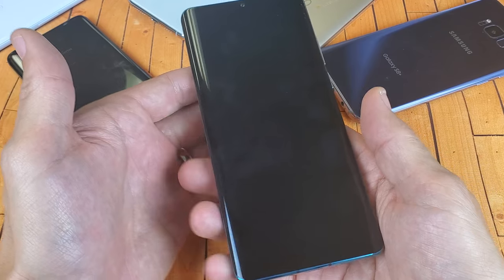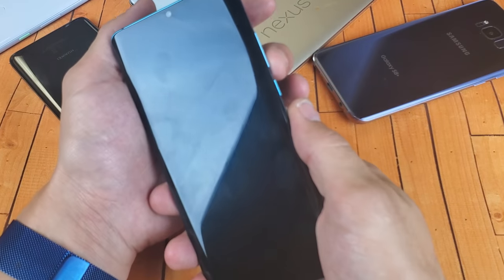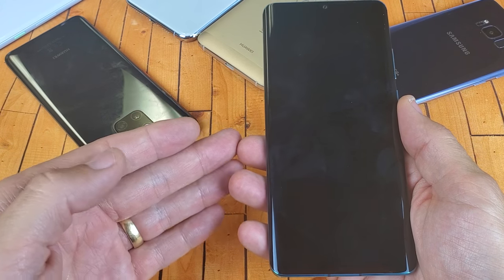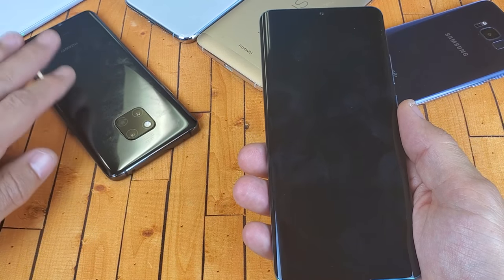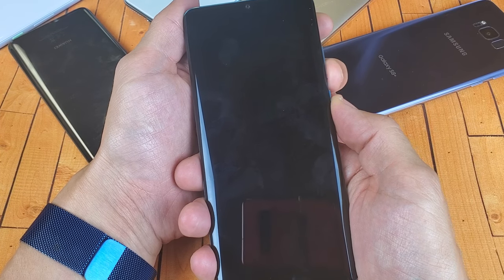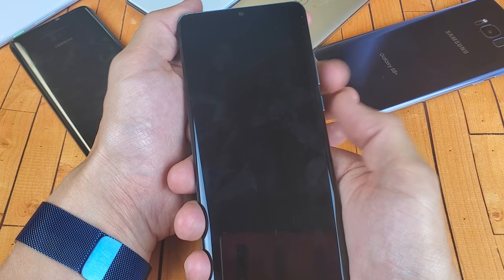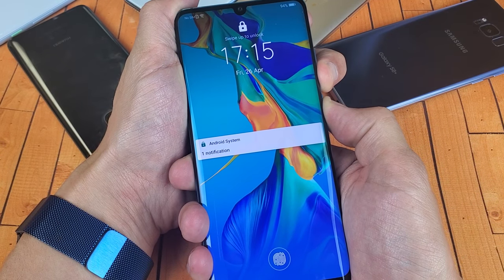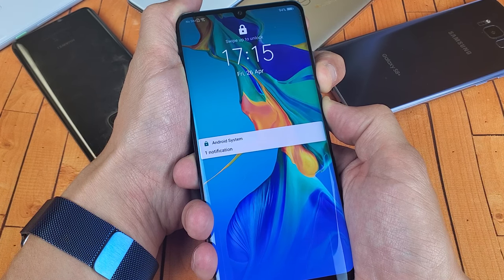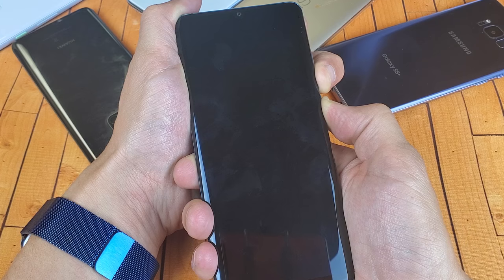What we have to do is a forced restart — it's a two-key combination. We'll press and hold the volume down button and the power button. This is a Huawei P30 Pro; with my Mate 20 Pro it's a different key combo, but for the P30 Pro it's volume down plus power button. Grab your phone and follow me. Press and hold both buttons at the same time — volume down, power button — and keep holding. Pretend my phone is black. Do not let go.